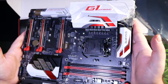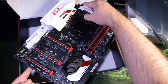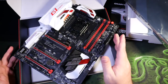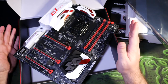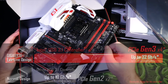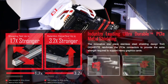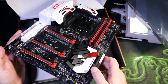As you can see, it's a clean, sleek-looking board — a nice black PCB — and aside from the basic design touches like the covering over the I/O panel, it also has fully customizable RGB LED trace paths and illumination over the I/O ports, which doesn't just look neat, it actually makes life way easier when you're trying to plug stuff in back there. The vital tech stuff is all here too: it's a Z170-based board, which means Skylake CPU with full overclocking abilities. This board even has a dedicated base clock chip to push things even further. There's USB 3.1 and the new C-type connector, enough room for three graphics cards with spacing adequate to SLI two big, thick, serious cards — something I just cannot come close to accomplishing in my existing rig. The PCIe slots have nice metal-reinforced shielding, and considering how often I swap in graphics cards for reviews and comparisons and tests, that's something seriously useful and welcome.